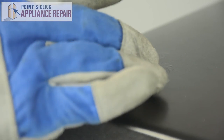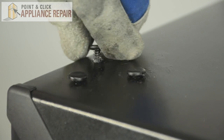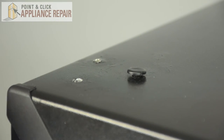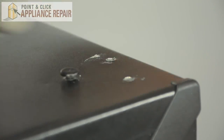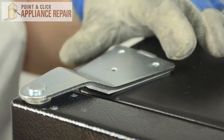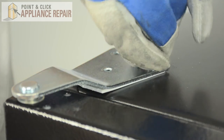And we can place the top hinge. There are going to be three space holders for the screws — we'll just need a flat head screwdriver to carefully pry up on these; they may actually twist out once you get them up high enough. Transfer the spacers over to the other side and push those in as far as they'll go. With a hand on the door, we can place the top hinge. You're going to want to lift up on the door slightly so you can align those holes. Once those are lined up, you can place the screws to hold it in place.